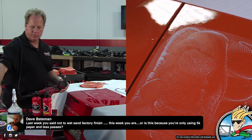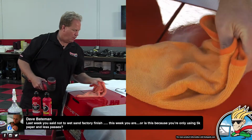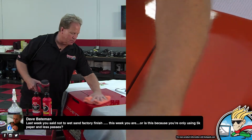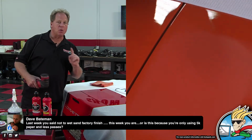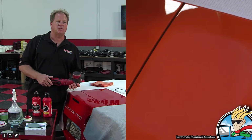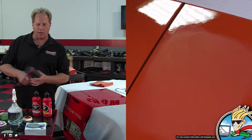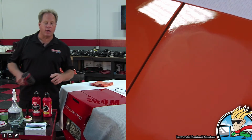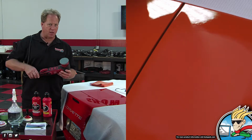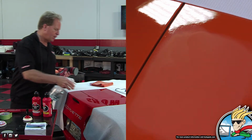Taking the 3,000 off. All right, last week you said not to wet sand factory finish. This week you are. Or is this because you're only using 5,000 paper and less passes? Oh, I did say, you've got to remember I'm a writer, so I pick my words very carefully. And I think what I said is most people shouldn't be sanding factory paint. And that's when I go up on Facebook and I see everybody and their brother wet sanding the factory paint on some car and then later on burning through, blowing through it. So I am using very high quality products. These things are not only high grit, they're expensive. I'm using a very safe tool, no pressure. I'm being very careful, and I have the owner's permission because he trusts me. But thanks for asking that.